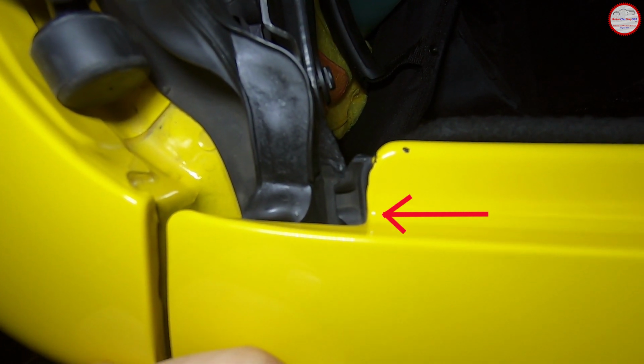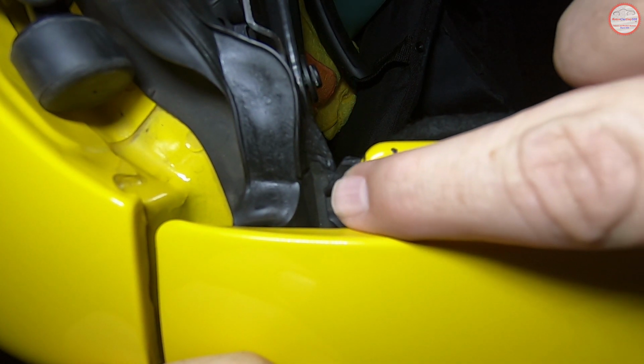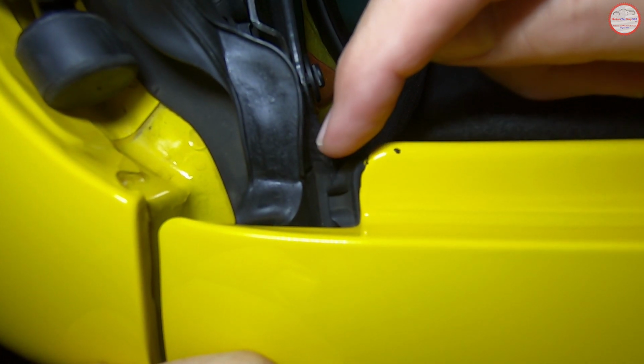So I usually clean both the tailgate and the rubber seal, insert some silicone in between the two, and use a little piece of tape to keep it secured to the side of the tailgate until it dries over a 12 to 24 hour period. This way, any water that does reach that seal will be properly routed into the side drainage channel instead of draining down the side of the tailgate and reaching into the cargo compartment.